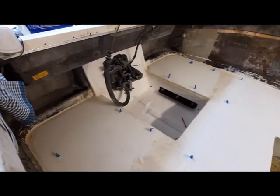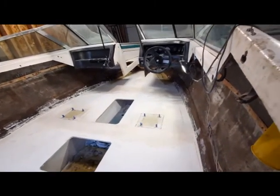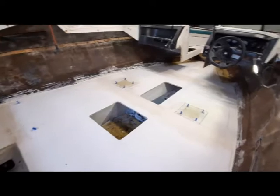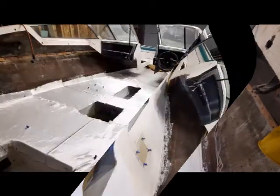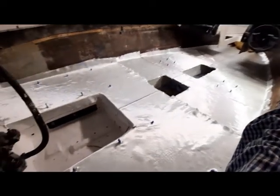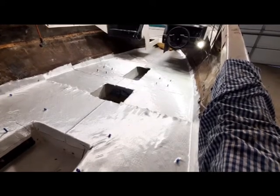The deck is on now. The deck is half-inch PVC, the kind you get at the home center. There's a layer of 1708 fiberglass on the bottom of it. You can see the bolts there — I used elevator bolts for mounting the helm chairs, and there are also elevator bolts positioned to hold down the battery boxes. There are holes cut in for floor hatches in the ski locker and in the new locker that used to be where the fuel tank was. I laid out another layer of 1708, got it all cut to size, and fiberglassed that in. It's tabbed up into the sides there, and that turned out to be a really rock-solid installation.